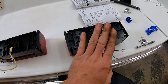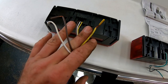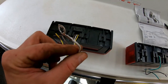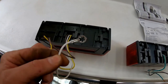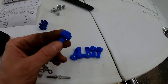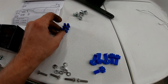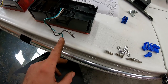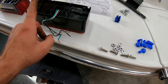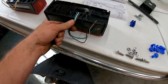On the back of the lights there are three wires on each. The wire colors correspond to the wire colors we just pulled through the frame, and then this grounds to the frame. I'm going to change out that eyelet because I don't really like it. They include scotch locks and wire nuts in the kit, but we're not going to use those. I have some heat shrink butt connectors that we're going to use. First, we'll go ahead and mount these lights to the trailer, since the wires come out the bottom, and then wire into the harness.